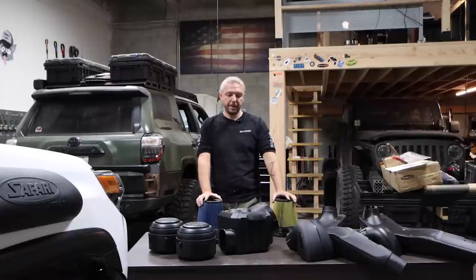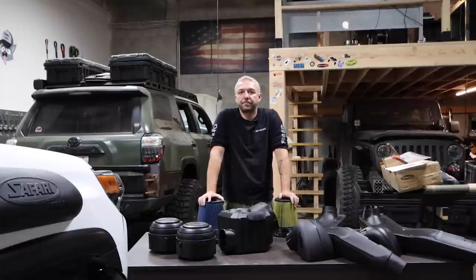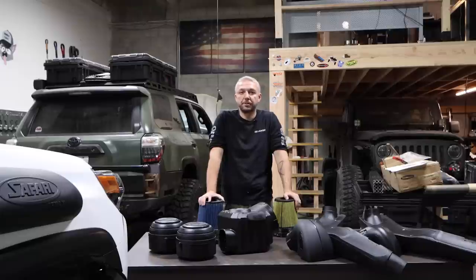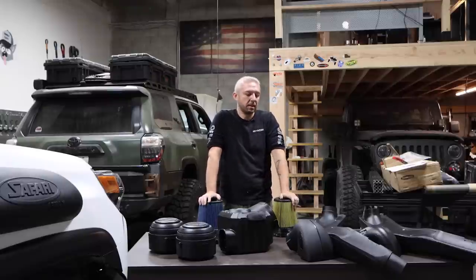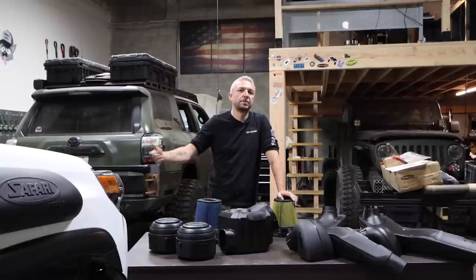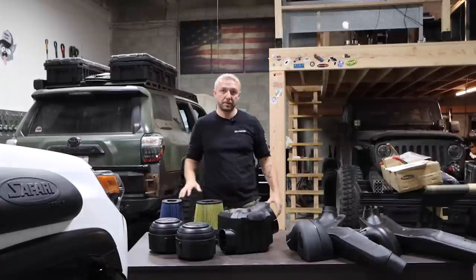You really have two options. Option one is you start upgrading stuff. Option two is you maintain your filter - you don't need any of this. To maintain your filter, every other day on a long trip, blow it out, carry a spare filter or two. But if you're doing week-long trips once a month, it gets very tiring to constantly check and maintain everything. That's why I want to build it as bulletproof as possible so I can just enjoy the trail.